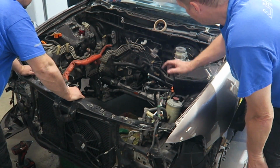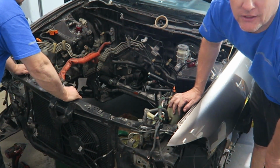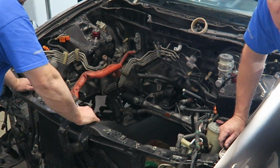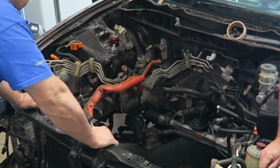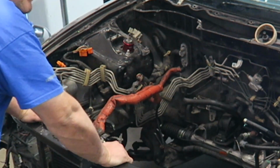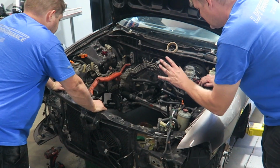So I know someone's gonna comment, why don't you shave the engine bay and why don't you put RS lines in? Well, kind of want to keep the ABS, especially when you're making a little bit more power than stock. Especially when ABS works that well, it's probably a good safety concern. Yeah, so, by 01 the system worked very well. Yeah, it was a newer system, so we're going to keep that.